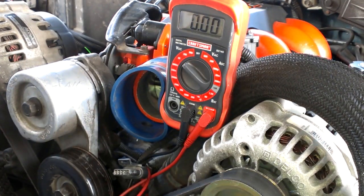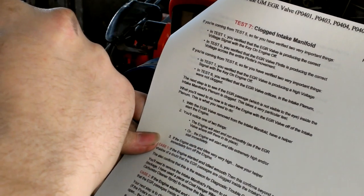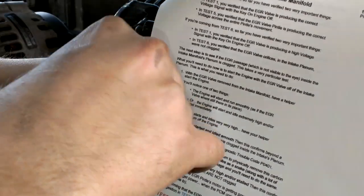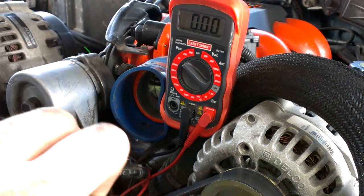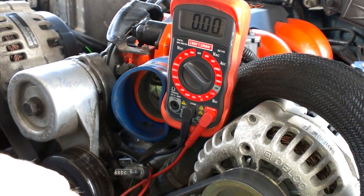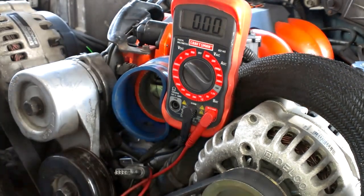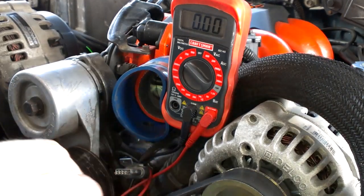We need to go to test seven. Here's where it gets kind of fun and interesting. A clogged intake manifold — what you want to do is leave your EGR valve off and start the engine. I already did that, and what's supposed to happen is if it's not clogged, your engine will rev up really high, run really poor, or won't even start at all in some cases. If it does, shut it off really quick — the passages aren't clogged, they're fine.